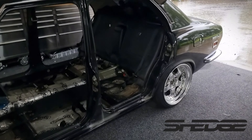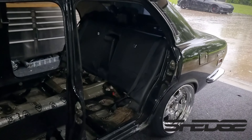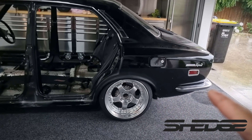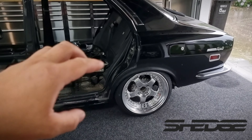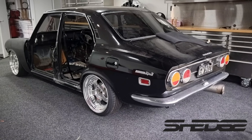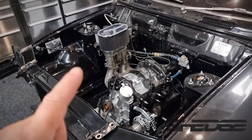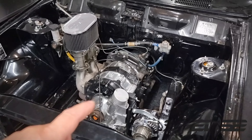Now let's move on to the back. Basically we're going to be gutting this whole thing out from that point there backwards — it'll just be a bare shell of a car. We're going to be doing like an effect where it'll be two new chassis rails coming up here like a big C-notch really, and then doing false floors and wheel tubs, because no doubt with how low I want this thing it'll be having to cut out inside there and cut out inside the actual door frame as well. I'm not too sure yet if I'm going to go bridge port or peripheral port — we'll see once I pull the motor apart and check the condition. It won't cost any extra to do a peripheral port or bridge port; when you build a motor you only build to one standard regardless of whether it's an extended port, six port, or peripheral port.